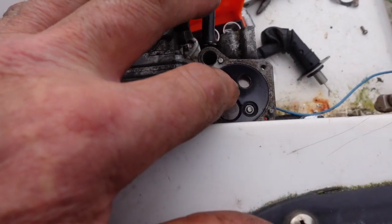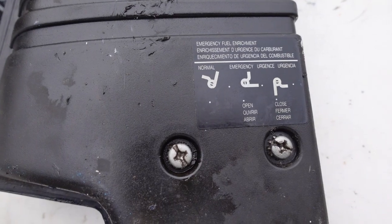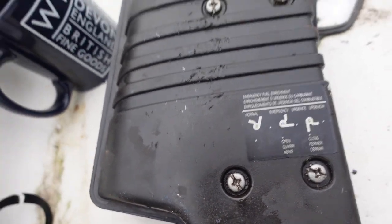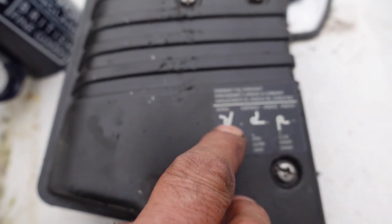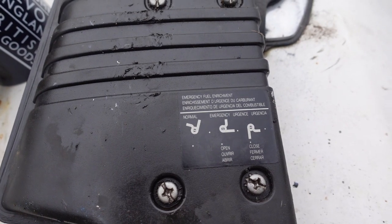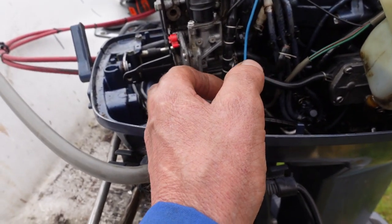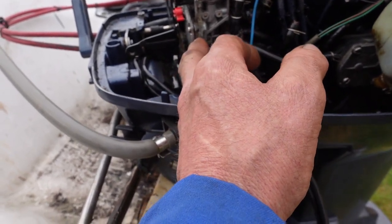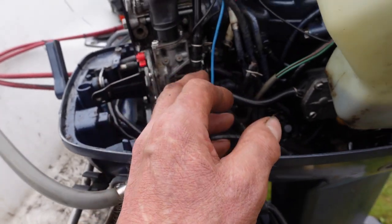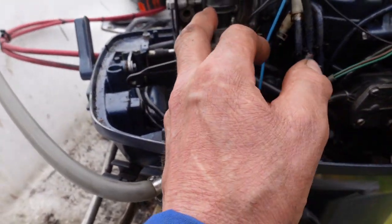What I've discovered now is the reed valve holder is cracked just there, so that is one problem with this cold start device. There is a small o-ring on the end of the plunger fastened to the end of this red lever, and if that o-ring fails it will not permanently close the cold start, so it could be constantly over-fueling. The practical side is the thing over-fuels direct into the crankcase until the wax motor turns it off.